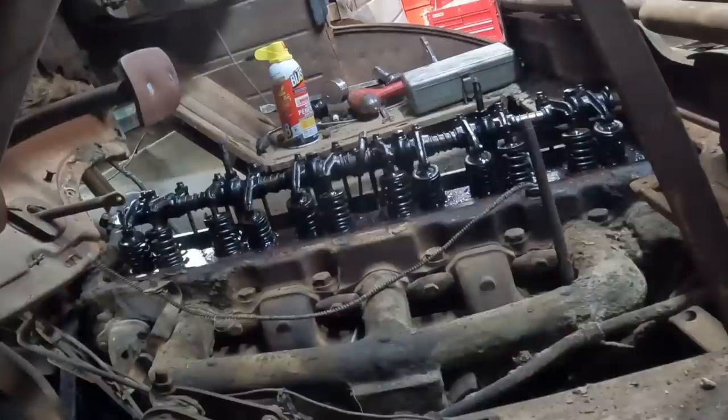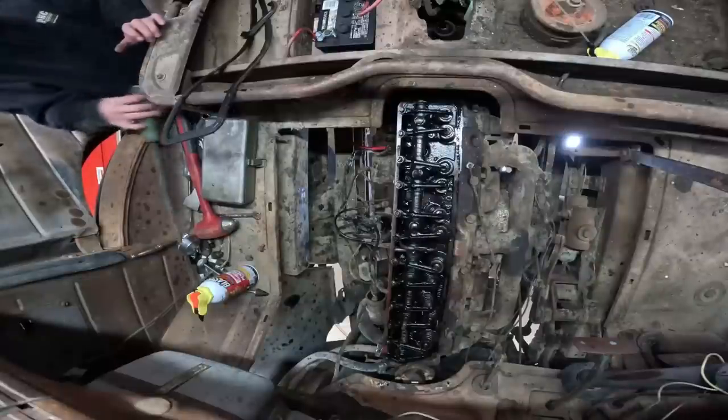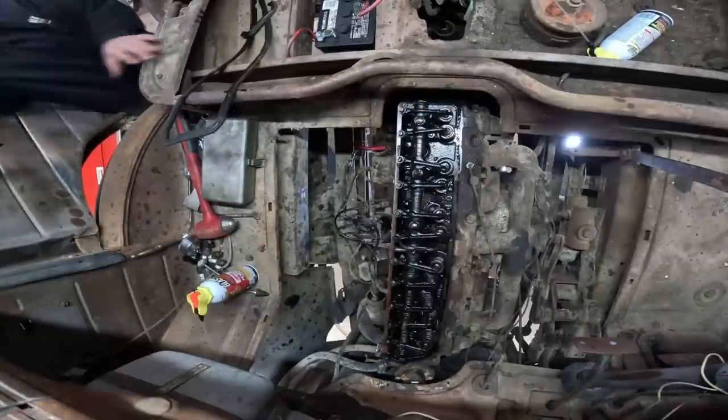Cylinder 2, you likely have a stuck valve being a zero. So just spin it and watch the intake and exhaust valves and see if they're moving. They were all moving. They moved pretty well. You got a borescope? I don't, but...